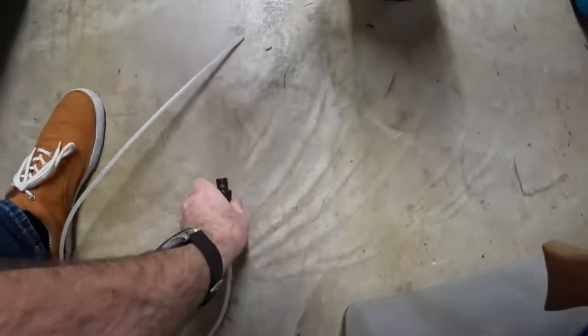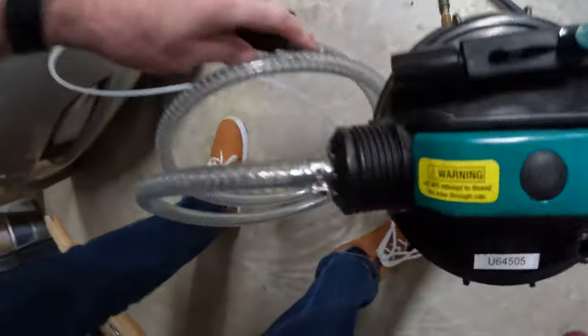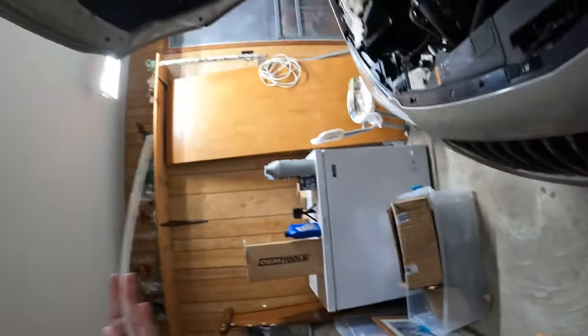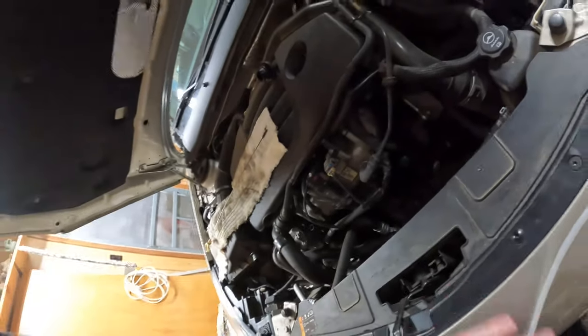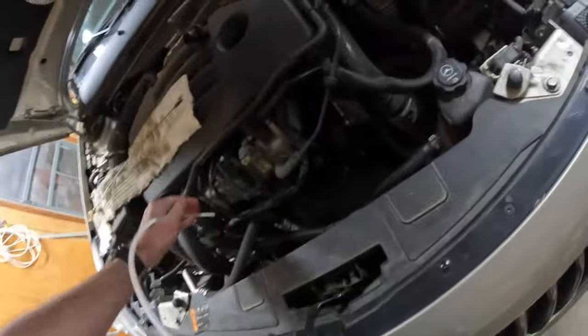Then you take this piece — it goes into here like that. It's got an O-ring. You will feel it; feel it click. It's not very pliable, it's very stiff. Take your dipstick out. What I'm going to do is when I take the dipstick out, I'm going to lay it right there. And I will take this tube and feed it into the dipstick tube until it hits bottom.